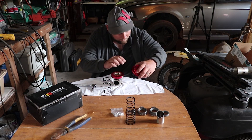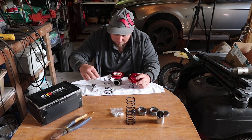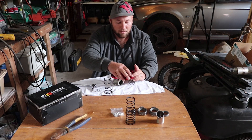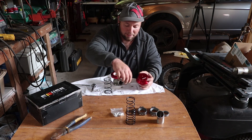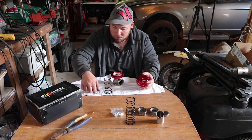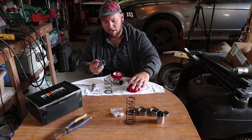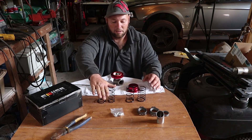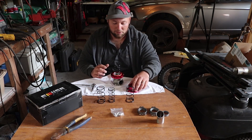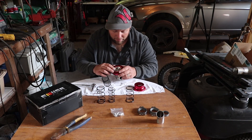I used my hand and held the spring down - it had a pretty decent heft to it, but I went ahead and held it down while unscrewing it. You're better off using a vise or some sort of wood clamp. I'm keeping organized with my screws so I don't lose them, checking the spring and feeling the tension. I'm going to put the softest spring in there - I think it's a 7 psi spring. I checked for metal filings, debris, pulled out the diaphragm, checked the valve, made sure everything was good before reinstalling.